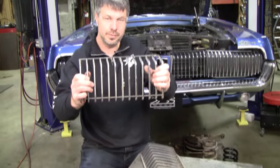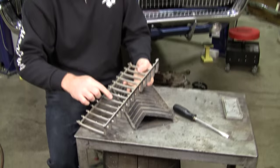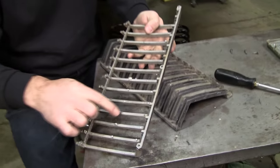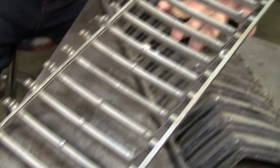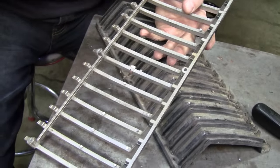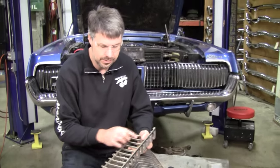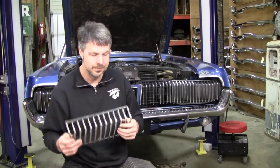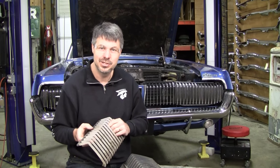There you go. When you remove your cores, that's what we want to see. Some people want to drill and tap and put screws in every one of these studs. I don't think that's necessary. Look, you already got six screws around the perimeter. You got all these studs here. A drop of epoxy when you reinstall these on your rechromes is all you need. So hopefully that gives you some ambition to tackle what seems like a hard job but isn't.